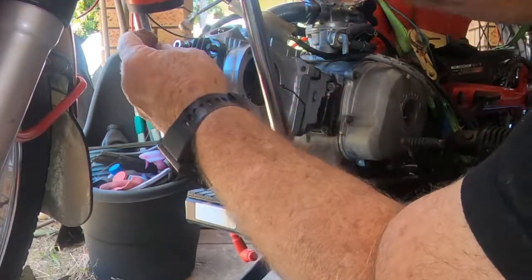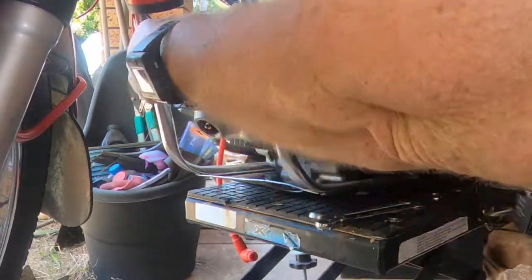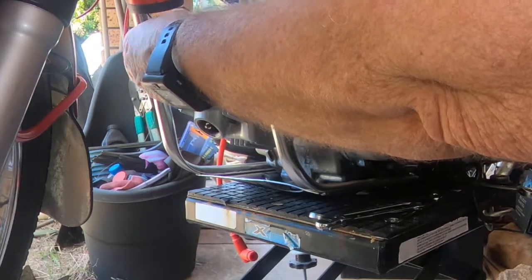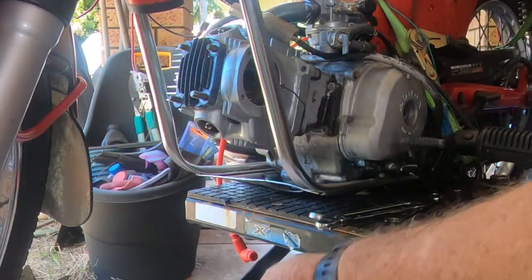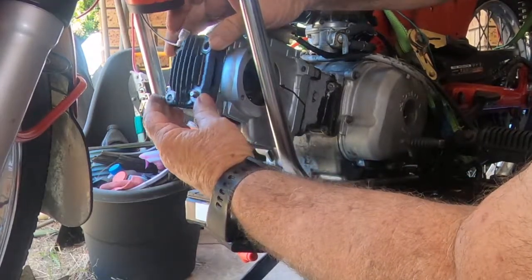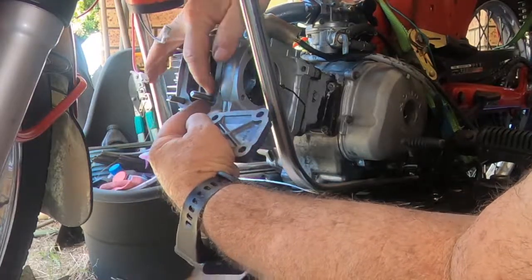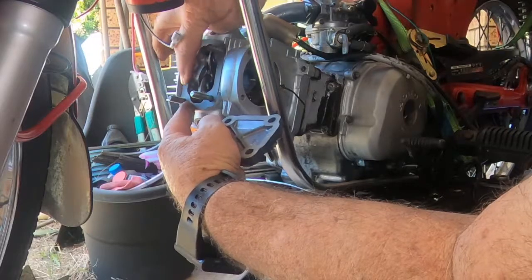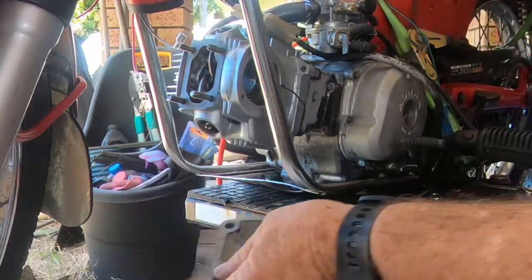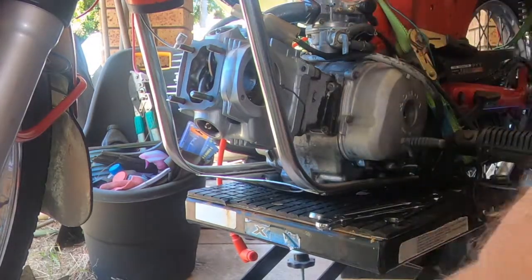You should never have a nut directly down on an aluminium case or piece. There should always be a washer. It tends to gall the aluminium. You might leave that in place. As he's used a new gasket, the engine's never run with it, so it should be right.